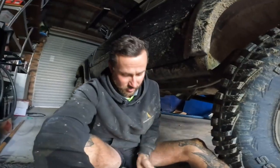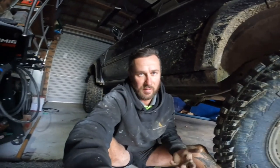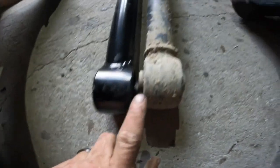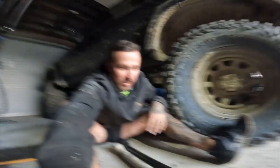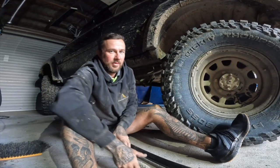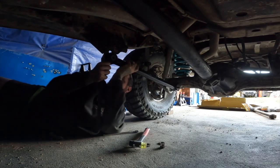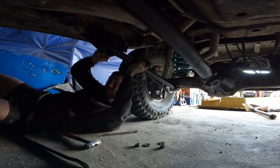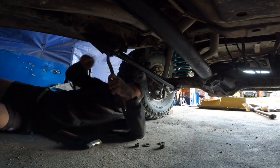You can buy adjustable ones to obviously suit your lift depending on your lift. From where I ordered them — Roadrunner Offroad — it just said 11mm to suit anything bigger than a two-inch lift. So we've gone and gotten that, as you can see — it's slightly bigger. I've got the bolt on the other end just so they line up. And then I've got adjustable uppers to get my pinion angle correct. And then just pry it like this until it wants to go through. Another good little thing with the kit from Roadrunner — they send new upper control arm bolts.